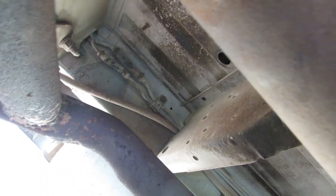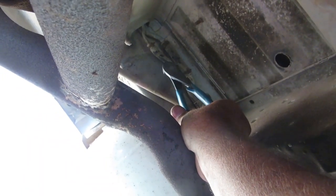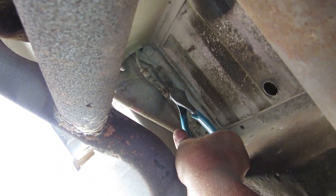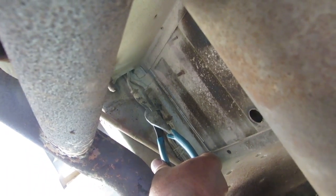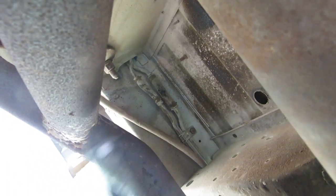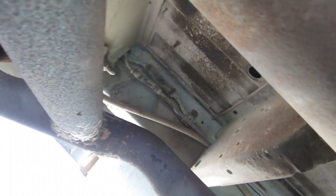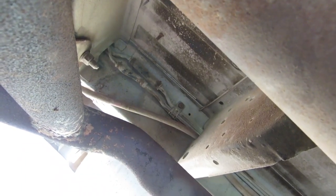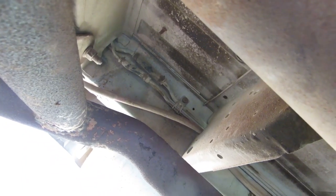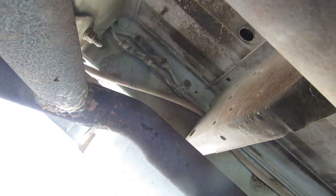While looking, I noticed some things that look dangerous — an emissions line and a fuel line. They're rubber with squeeze clamps, or they once were rubber. They're no longer rubber; they're all eaten up and I'm going to have to replace those. I've replaced my main line up front that goes from the fuel pump to the carburetor. Gas isn't a good thing to fool around with, so we'll have to look at those in another video.